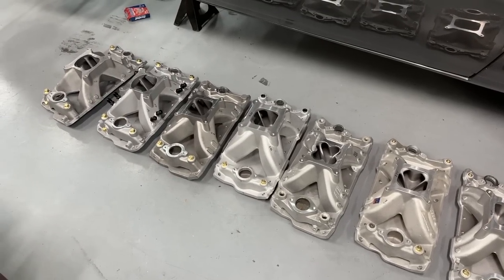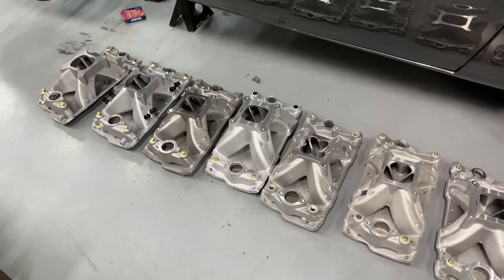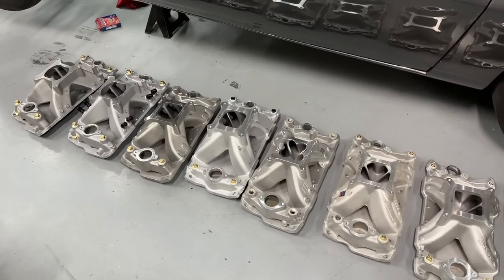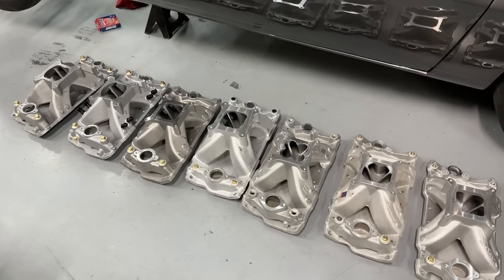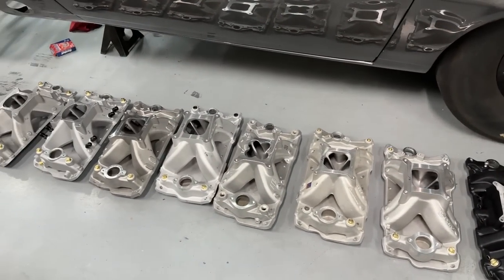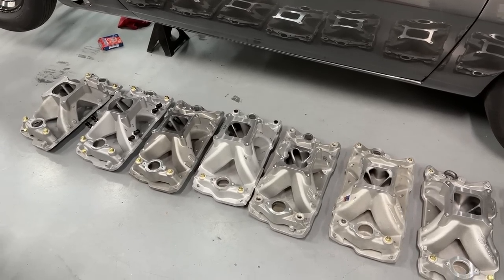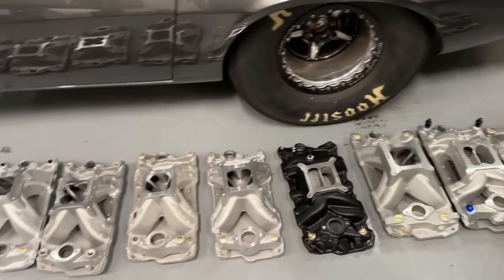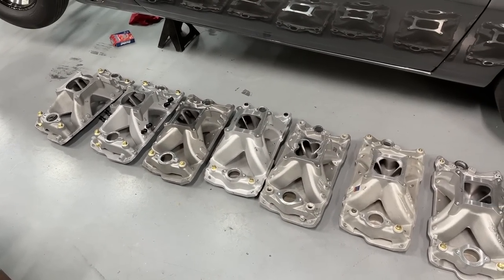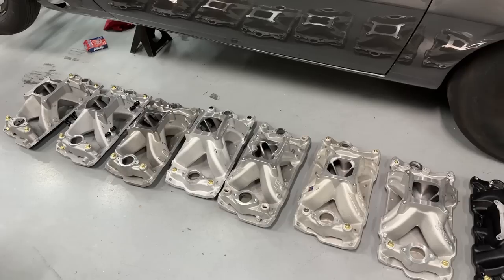The intakes are all these. The carburetor used for the two-barrel was the one that Gary Dunsworth had — he uses it for his dyno all the time, it had an adapter spacer on it and I think it's like 500 CFM, spec legal. The four-barrel is my carburetor — it's the 1,000 CFM Demon redone by Mark Whitener, with annular boost, a really nice carburetor. We did not change any jets for this entire test, and the air-fuel ratios were so close. Switching from all these manifolds, the AFR did not vary more than three-tenths — period. So try that with fuel injection.